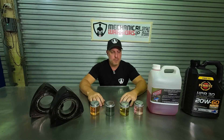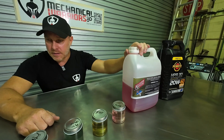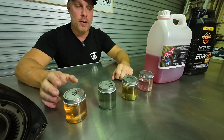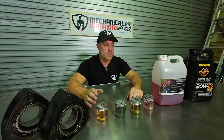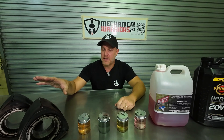In summing up, we've covered lubrication inside the engine and inside the combustion chamber for apex seals. We've covered which types of fuels can be used in the rotary engine and what boost levels you can achieve with them, as well as some of the byproducts and problems that the different fuels and oils present inside the engine.